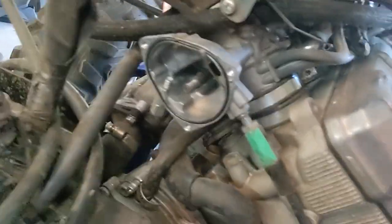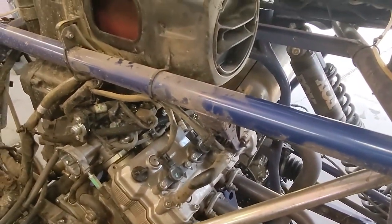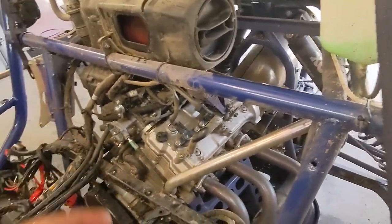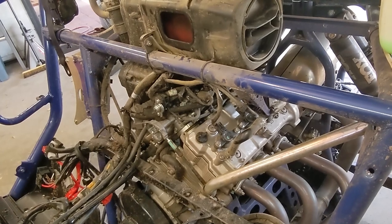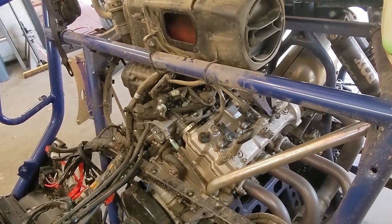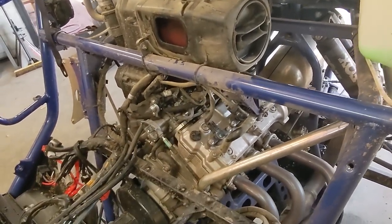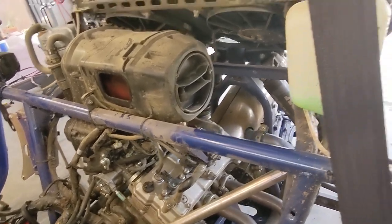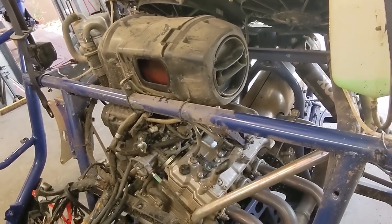Once you get movement they're okay, but they stick closed. Worst case scenario, this issue is related to the throttle body, and I suspect this is the case for most people who have this problem. Everyone's lazy fix is to lube the cable or whatever, but the throttle body sticks. It doesn't close all the way and it gets worse when it's hot. When something gets worse with heat it generally means it's not a cable problem — it usually means it's something to do with the actual butterflies or the throttle body not being aligned right or not being greased right. So now I'm going to pull off the air box, remove the throttle bodies, and see why they're sticking.